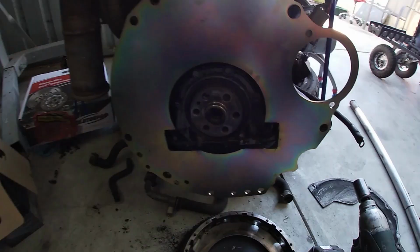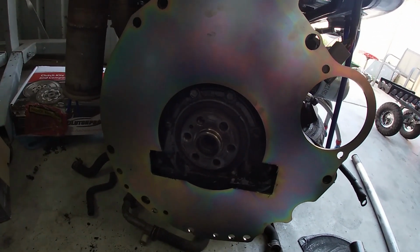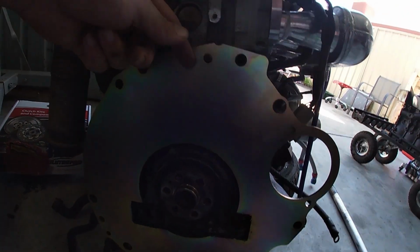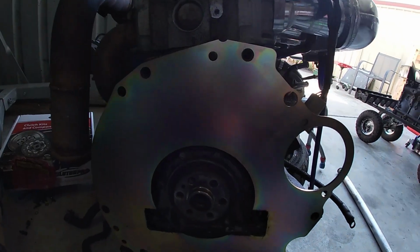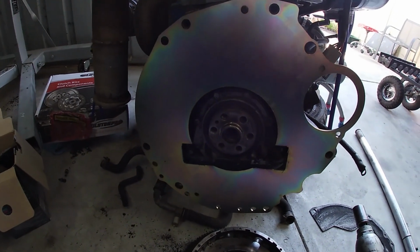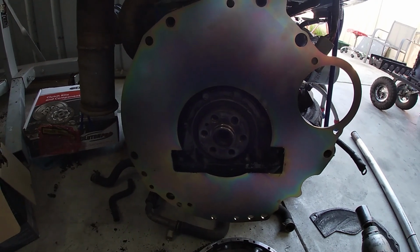Now we just need a Bellhousing on. Oh sorry, put the flywheel and clutch and all that back in on, and then measure from there back to the fingers on the pressure plate. And then they'll use that measurement that we got before and that one to work out the play that they want between the slave and the fingers on the pressure plate.